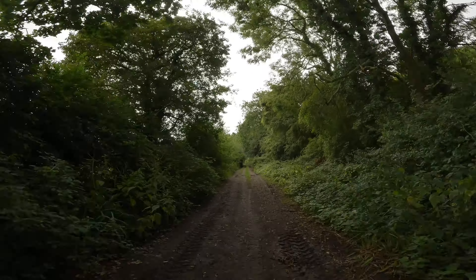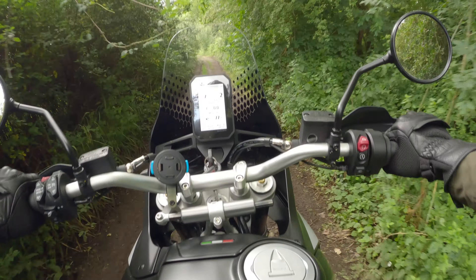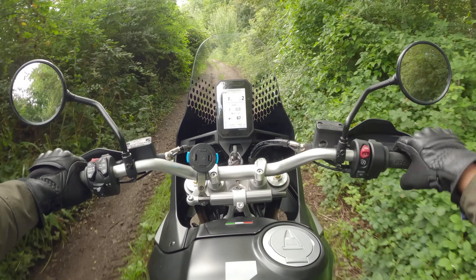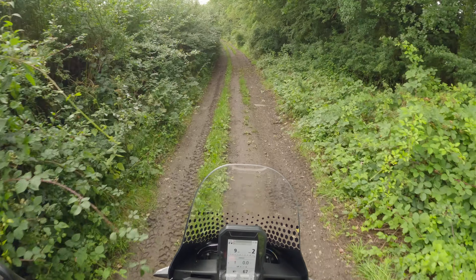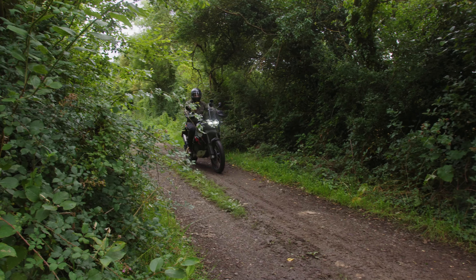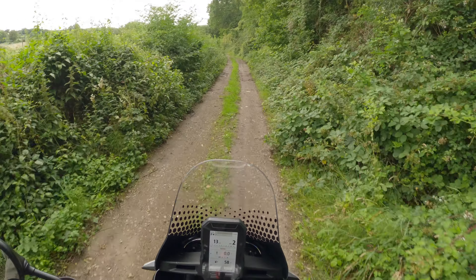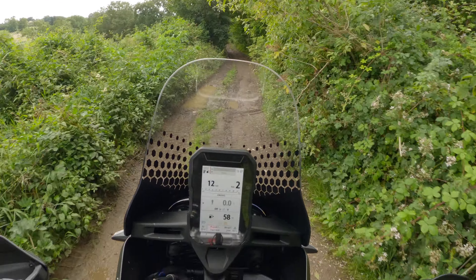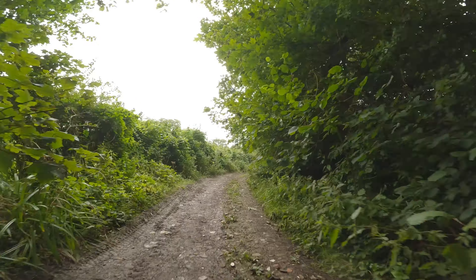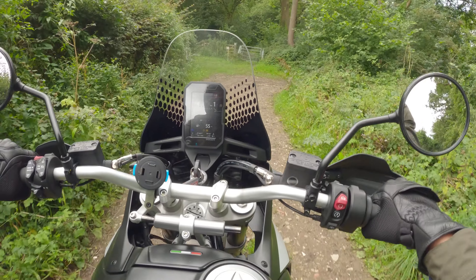So far this bike is making it quite easy. The handlebars are adjustable — they can be twisted up to make it more friendly for off-road riding and standing up, then adjusted back down for more comfortable road riding. That's a mechanical adjustment requiring tools. There's another one on the rear brake and foot peg — you can twist it 180 degrees upside down so it's easily accessible when standing up, then clip it back around with no tools required for road mode. Now it's getting a little more slippery — the back end is sliding.